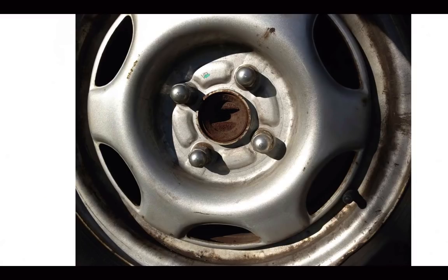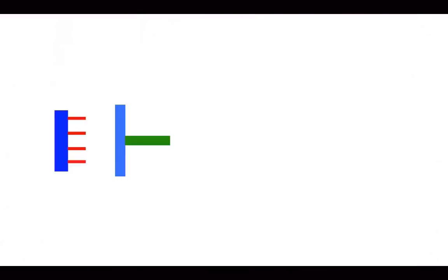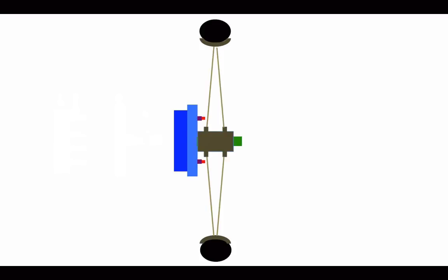Here is the rear wheel of the Toyota Corolla that we used. This graphic depicts the car's hub — that's the hub, and those are the bolts. And this is what Brian designed: a plate with a shaft welded onto it. The shaft has to be 22 millimeters to match the internal diameter of the hub of the bicycle wheel. This graphic shows the car hub with the bracket slid onto it. The mounting bracket is secured with lug nuts, my wheel slides onto the shaft, and if we cut some threads into the shaft, we can affix the whole thing in place with a lock nut.